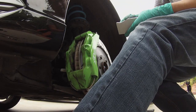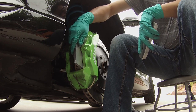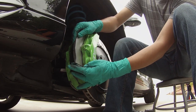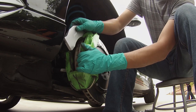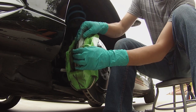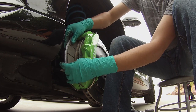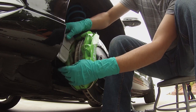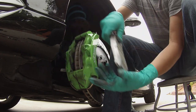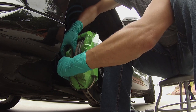So again, you've pushed everything in. There are no markings to indicate which side is left or right, but if you find it's a little troublesome — right now one side will go in but one won't — you just push a little bit with your fingers and the piston will push in, just like so. These slide perfectly right in. Same thing over here: one side goes in, one side doesn't — just give it a little push. Sometimes you have to do it with two fingers because when you push in one, another one wants to pop out.